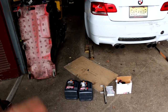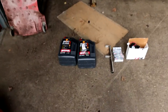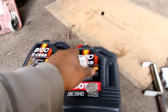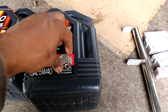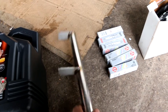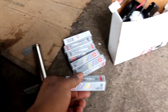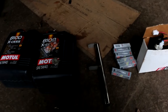Right now I'm prepping the car for the tuner — we're going tomorrow. Today is Friday. Instead of running 5W-30, I'm switching to the Motul XS8100, which is 5W-40. I also have a magnetic drain plug with crush washers, a spark plug gap tool, and the fuel pump removal tool. We're going two steps colder on the spark plugs with these NGKs — part number 97506 — and then the Stage 2 low-pressure fuel pump by Fuel-It. We need to get all these on the car before we go to the tuner tomorrow.